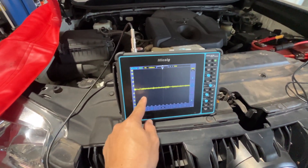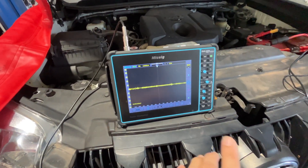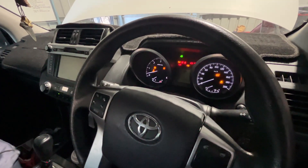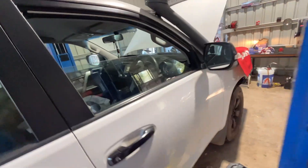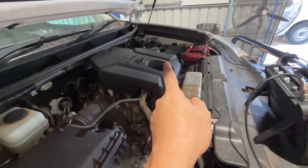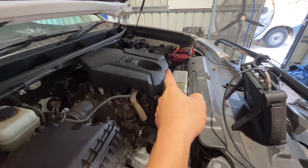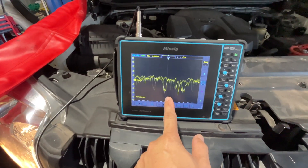The ripple test is supposed to be an even up-and-down wave, like this — a wave up and down. We'll see what the result is. I'll try to start the car. The battery is not strong anymore, and you can see there's a noise. Hopefully that noise is the bearing on the alternator — I'll check that also. And you can see the ripple here is not quite good.